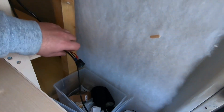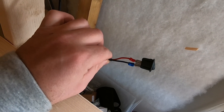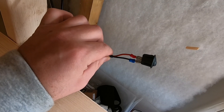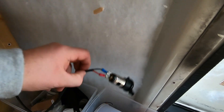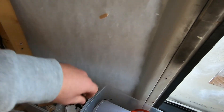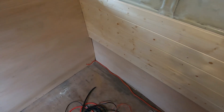For the lights, quickly: we have two lives — one live goes from the light switch to the live on the fuse board, the other live goes straight to the live of the lights, and the earth of the lights goes to the fuse board. On the 12-volt socket we've got a live which then goes straight to the live on the fuse board. It's as simple as that.